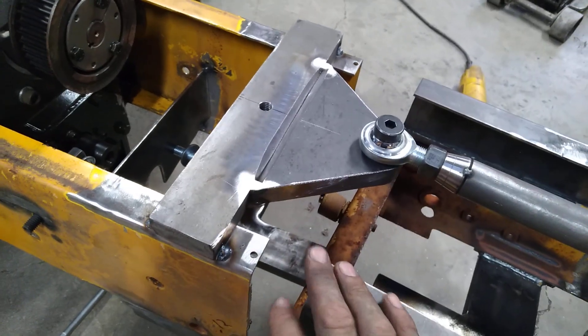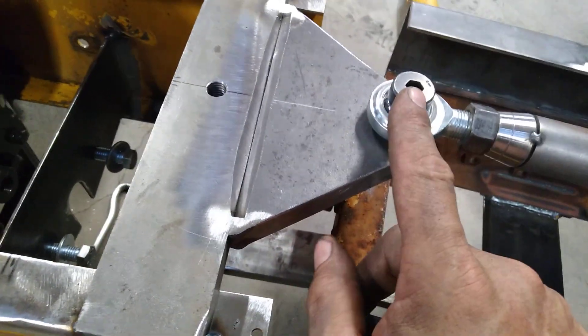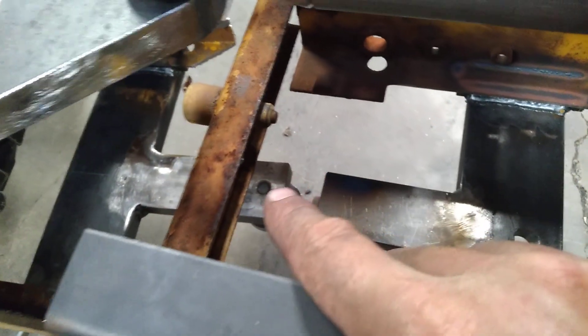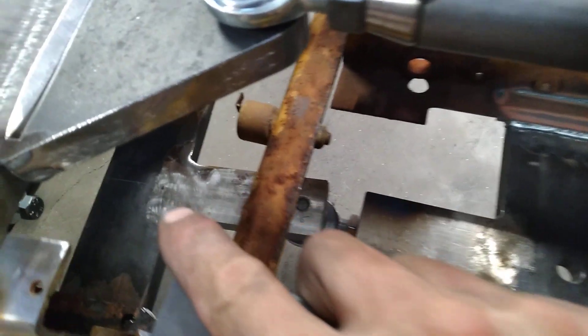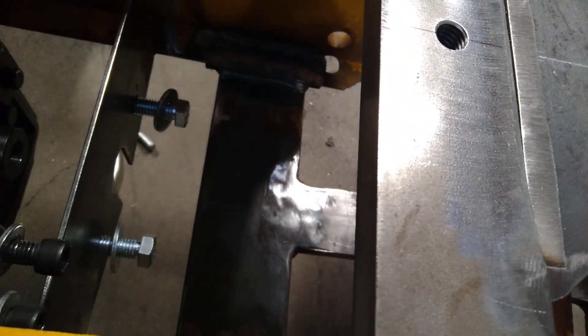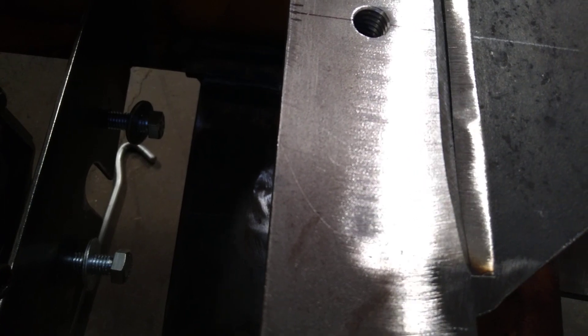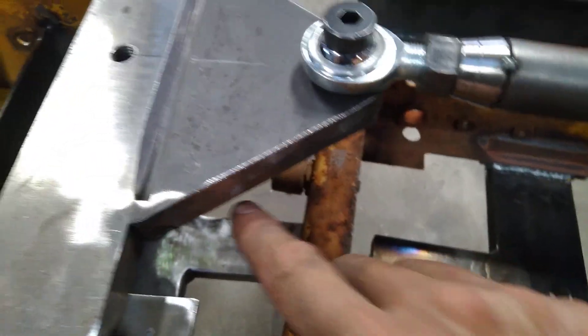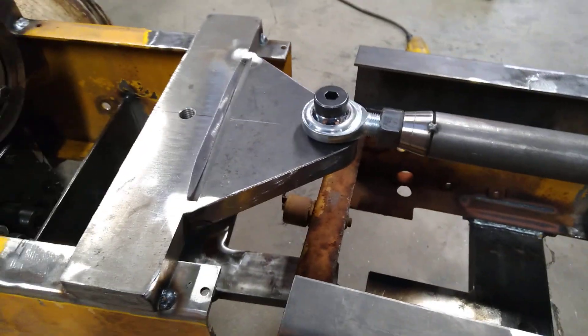So it looks nice. This is the original hole, obviously. So yeah, that's what I did and I just got this pivot lined up directly above it. To do that, I took a measurement from the center of this hole to this back line right here — this back part of the bar — and that was five inches exactly. So I came down with my little ruler and measured five inches from the middle of that to that mark right there. Then I took a plumb — like old school, pointy heavy thing on a string — and hung it straight over the top of this and it pointed straight down to it. So if this is five inches from here to here, and it's five inches from there to there, and this is straight above that right there, then that means these are right on line.